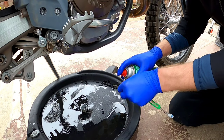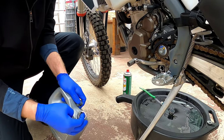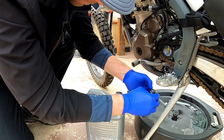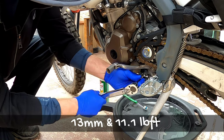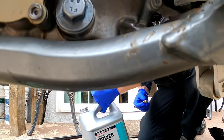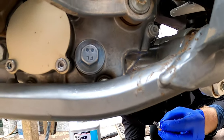We're using a toothbrush to get the bits out. I'm ready to put the bolt back on now — I'm just going to dip my hand in fresh oil and kind of oil up the threads a little bit. So we've still got our 13mm bolt, just going to tighten this up. Torque spec is 11.1 foot-pounds. So it's time to put the main drain bolt back on, and he's just putting some fresh oil on the threads.